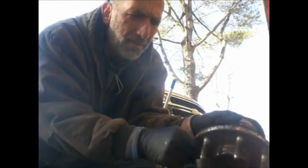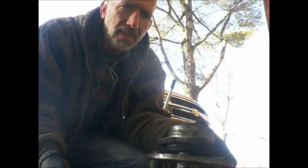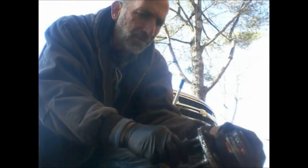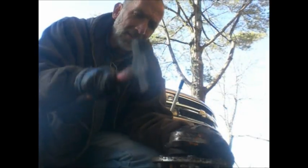And make sure they're all seated. Don't swing the hammer next to the ABS wiring plug, because you'd be sure to miss, and whack! Off goes the ABS sensor. Make sure they're all seated. That wasn't too bad of an ordeal. That one could go down a little bit more. Which one is this one? More whack.